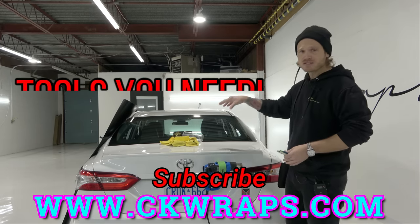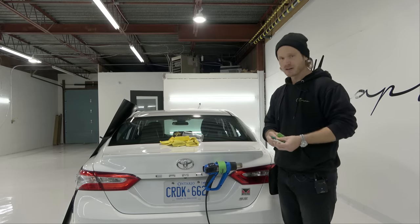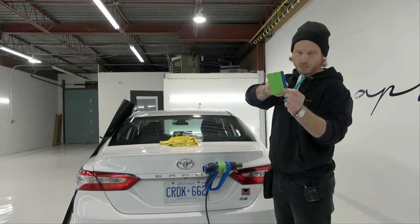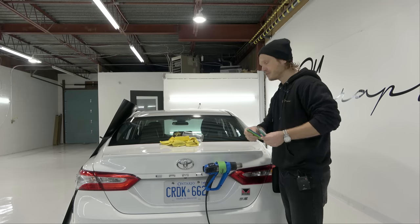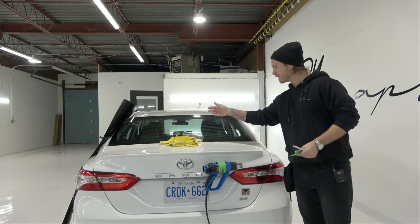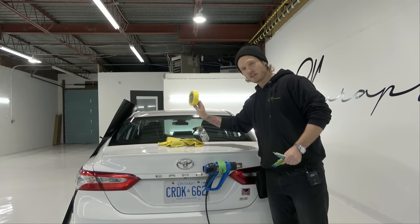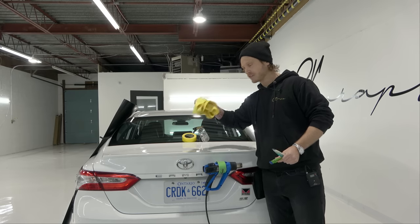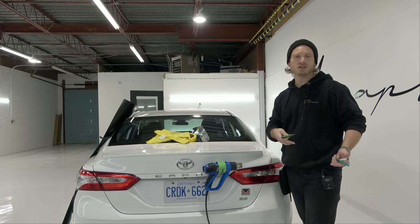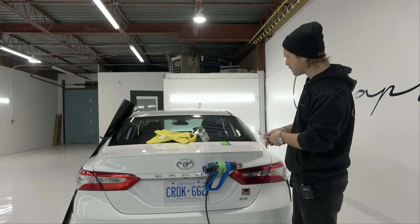Now what you're going to need to do this is a few things. We're going to need a knife because we're going to have to cut the vinyl. We're going to need a tucking tool. We're going to need a squeegee with a buffer on the end — this is called a buffer — so we're not scratching the film. We need a heat gun, some cleaner — I use 70% isopropyl alcohol — some masking tape, and a clean rag. The tools I'm using today you'll find linked in the description from Amazon, and I also have a link to Signmaker Tools.